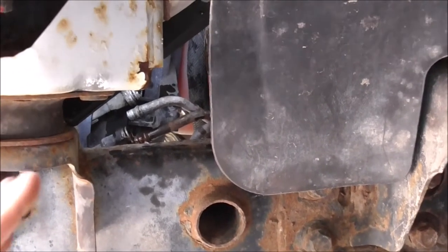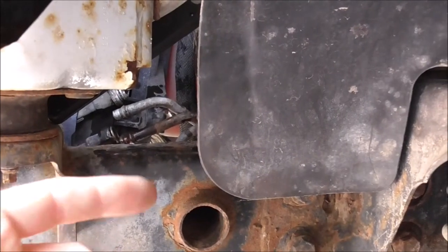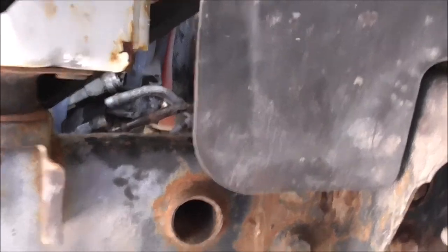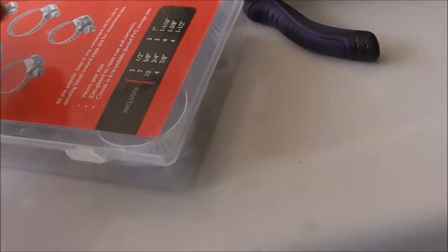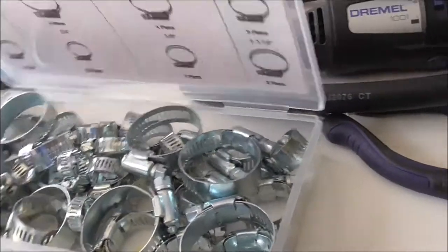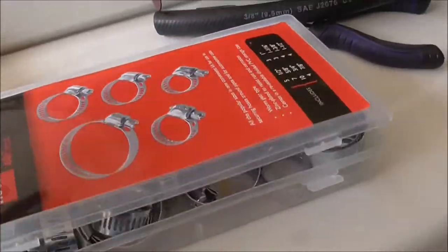I'm hoping I can get enough movement to cut it easier and replace those hoses. These clips you can just put back in after you get those out — it's a quick-release design, so when you go to put the hoses back in they just slide right on. Don't forget you will need hose clamps — you'll need eight total, two per side, so four on each line. I got mine at Harbor Freight a while ago for about five bucks.